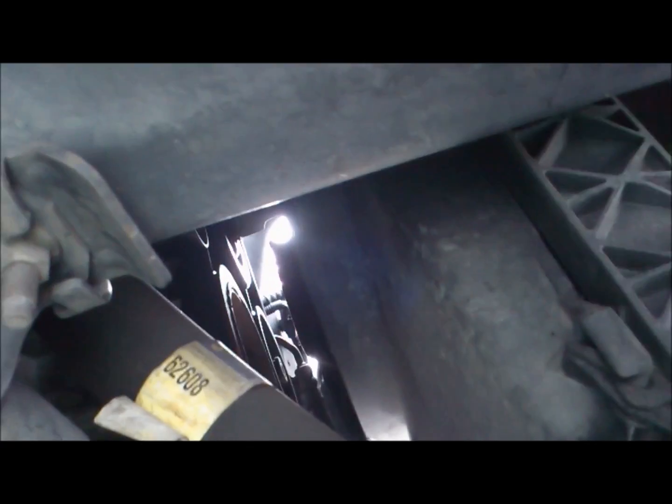Go ahead and move your oil pan, adjusting it, since the oil filter is directly underneath that little beam. Expect it to fall front and back of it and off to the side. So it's gonna get a little bit messy, and once you have it, go ahead and loosen the old one. To make it less dirty and keep yourself clean, just loosen it enough so it actually starts leaking down the oil filter. Kind of spilled a little bit, but very minimal drip, and then go ahead and remove it.